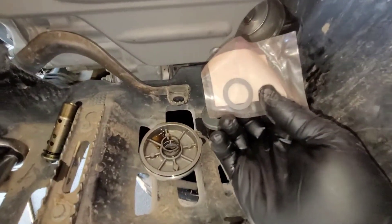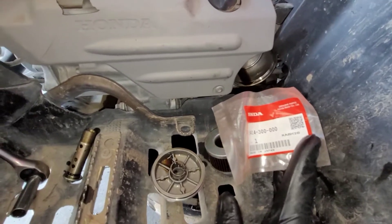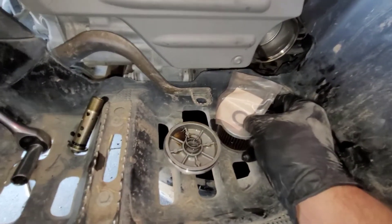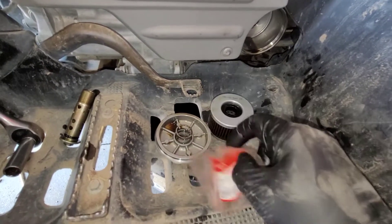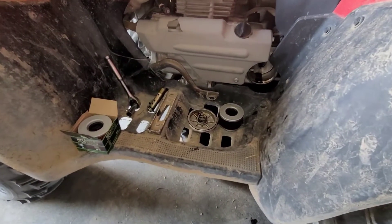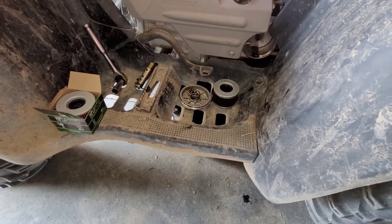If you're not familiar with these bikes, what we're missing is one of these — a Honda OEM steel washer, part number 15414-300-000. All it does is act as an insulator: it sits down on the rubber part of the oil filter and allows the spring to push against a metal surface instead of digging into the rubber. This is not a hard-use machine; it stays around the ranch compound and is used for running errands, guests riding, hauling garbage — nothing hard at all.